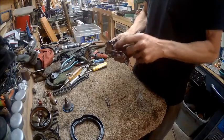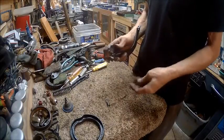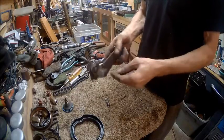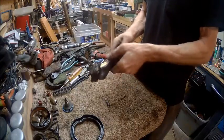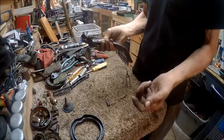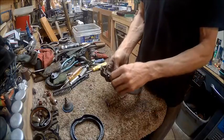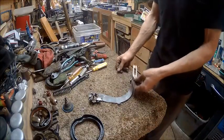But this bolt is pressed into this sleeve that holds all of it together and there's a spring on this. I've had these apart before, but I'm not comfortable banging or pressing that out of there because I'm afraid I'm going to break something — it doesn't have a flat spot on the back side to work with, so it's going to be pressing cockeyed. I'd rather just leave it and paint it the best I can, since it's going to be on the inside anyway. I want to slow down the rusting process so I have a longer time span before I have to do this again.